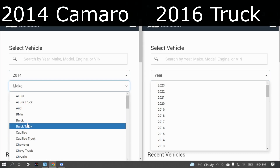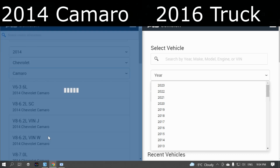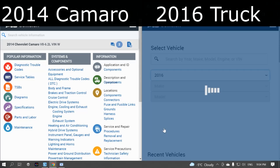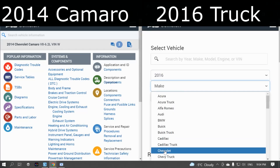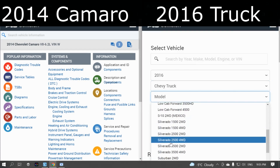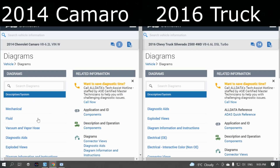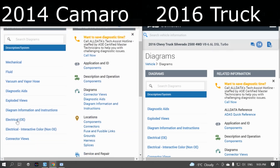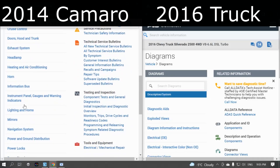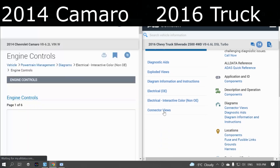I'm going to give an overview of how I did the wiring on the car. One thing that's important to note is the engine — the LML that the truck came out of — and the 2014 Camaro both run Global A electrical architecture, which means they're very similar in the way they're designed and wired. I'm going online here to get the diagrams pulled up. You want to go into the electrical diagrams, powertrain control — that's going to give us all the wiring definitions for all the pinouts on the ECM.